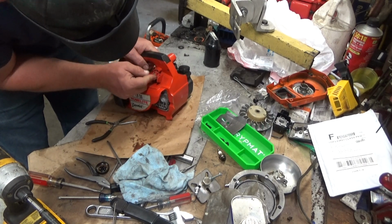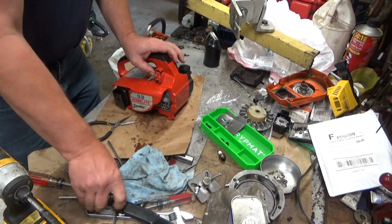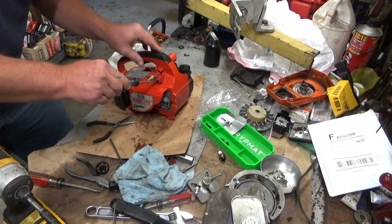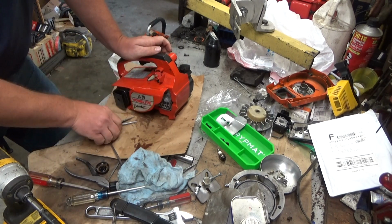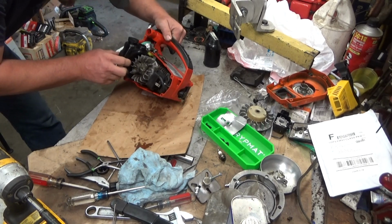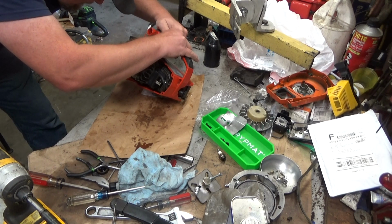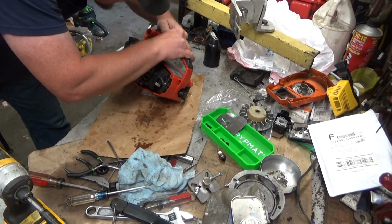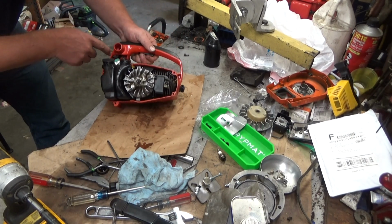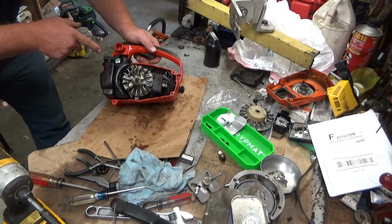I'm going to put the top in first, since the screw's at the bottom. And there it goes. And then you run your screw down. Just tight. I'm going to reset that to low before I forget. And I'm going to come back over here and make sure that nothing is kinked. And it's not. It's a sharp bend that it has to make with the oil valve, though. I mean, the tolerance in these is really tight. I say not Homelite's best design.